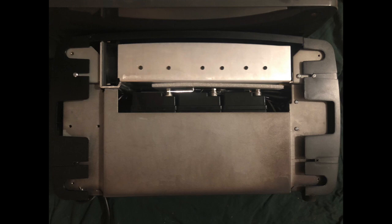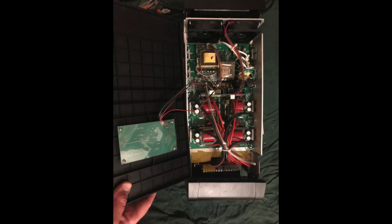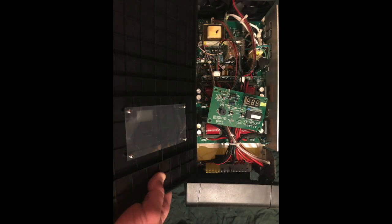The panels are adjustable when you're taking it apart and putting it together — you can loosen them, separate them, and adjust the space between the top and the front and rear. It makes life easier for a technician. With the front and rear panels loosened, it's easy to remove the top — it lifts right out. Do it slowly because the control panel is connected by wiring into the tray. I removed four screws, removed the acetate on top of the control panel, removed the control panel, sat it onto the tray of components, and put the acetate and screws back so I wouldn't lose them.